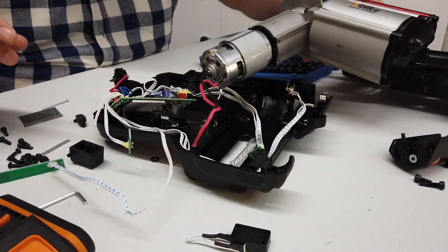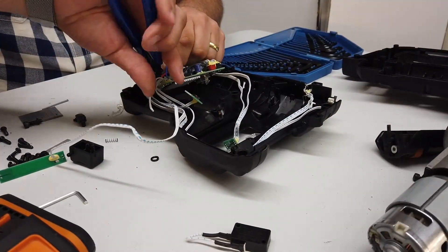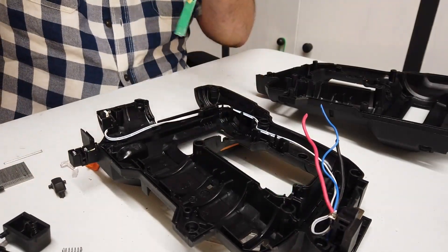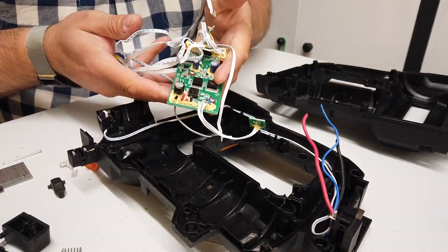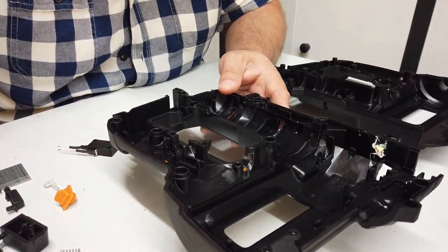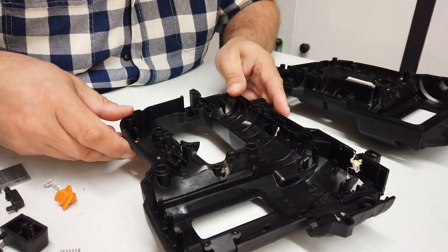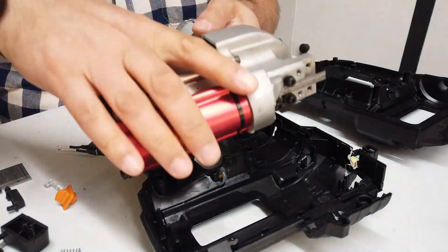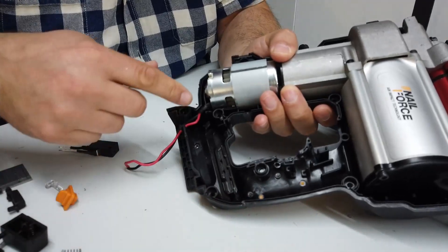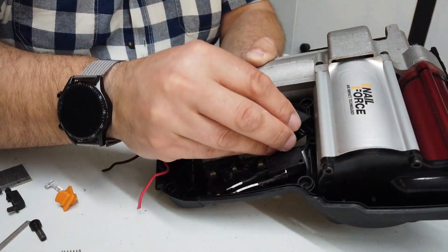So there we have it, that is the firing mechanism right there. All that control circuitry getting chucked out. We have quite literally removed everything. I've even removed the battery connector — I'm going to replace that with a 3D printed battery connector. This can go back in place, and what we can do at this point is wire up the switch here and fit that in place, so that we can turn on the motor manually.